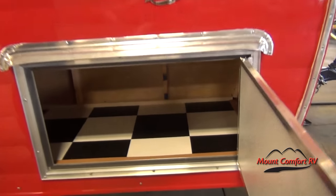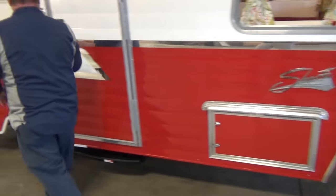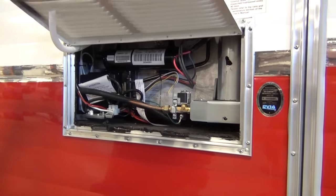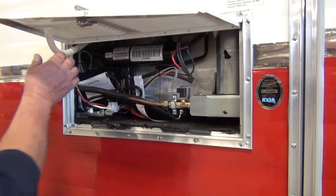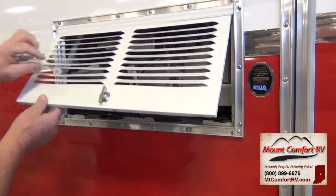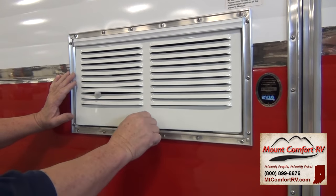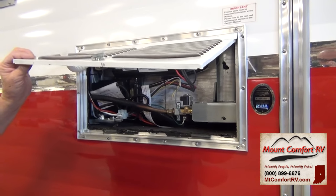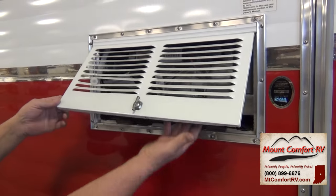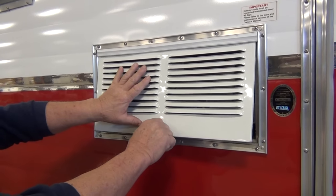There's a front compartment — this is basically underneath the dinette on the inside, so you have access from both inside and outside. This is the back of the refrigerator. It runs off 110, 12-volt, and LP gas. This is a drain tube for the fins inside — as moisture and condensation forms on the fins, it drips into a tray and then drips outside, so we want this tube constantly on the outside of the vent door. Now, we are using heat to cool the unit, so we don't want to block these vents in any way, shape, or form. Don't put any kind of screen mesh over it or on the back side, because that blocks the ventilation and the refrigerator won't work properly. Anytime the refrigerator is in use, we've got to keep these vent doors open and clear.